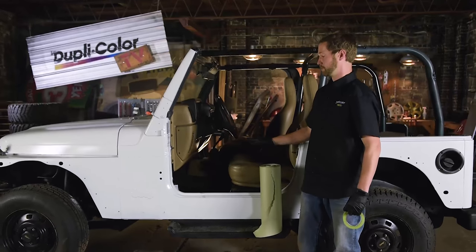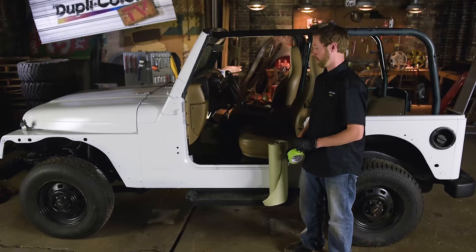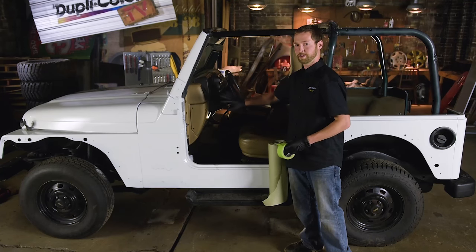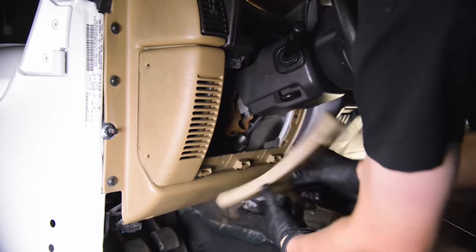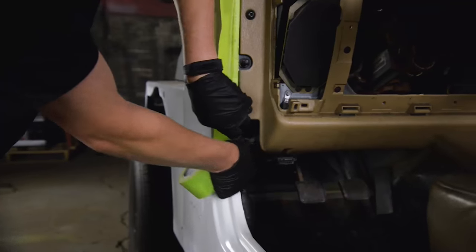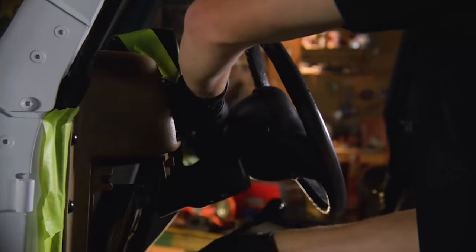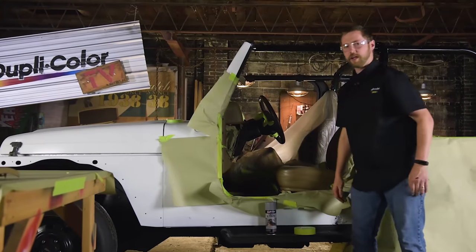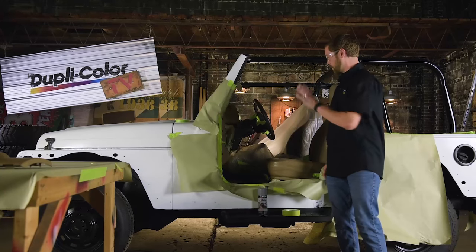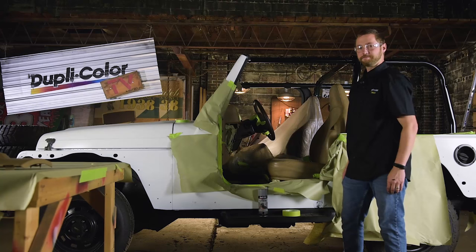So we just finished with the grease and wax remover. Now we need to mask off areas to keep overspray off the car. This product is suited for direct application to the vinyl, so no need to do a primer. Okay, so we're all taped up, pulled out some of the smaller parts here, and masked off all the areas that we need to cover. We're ready to paint. Let's get it going.